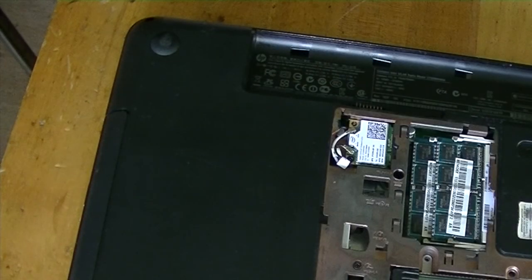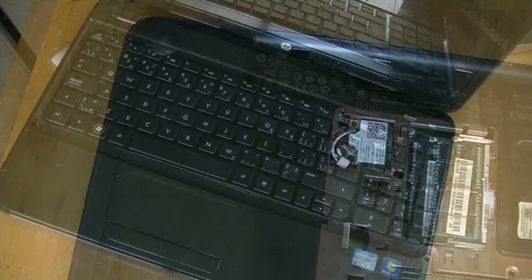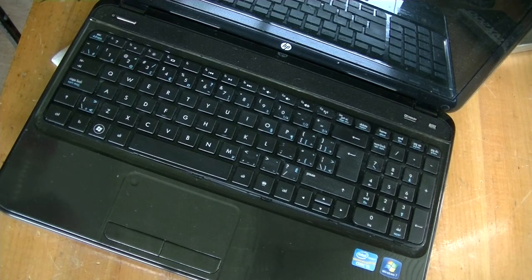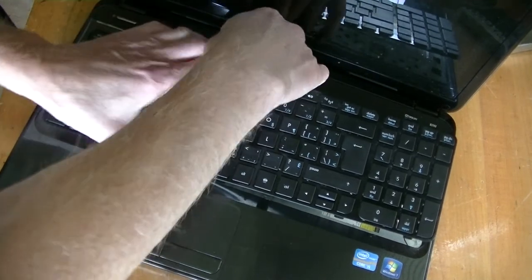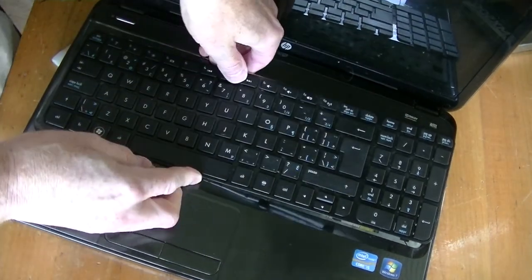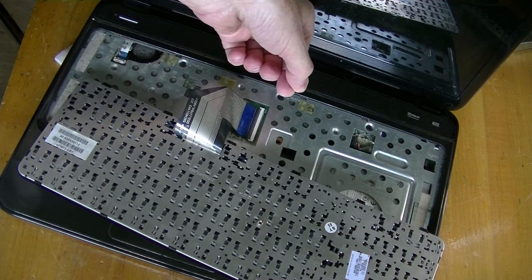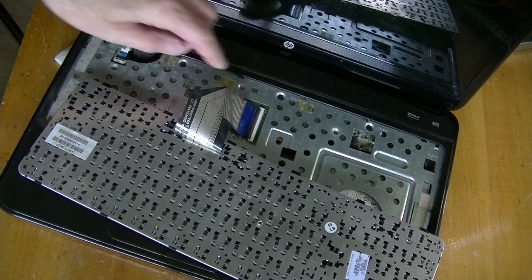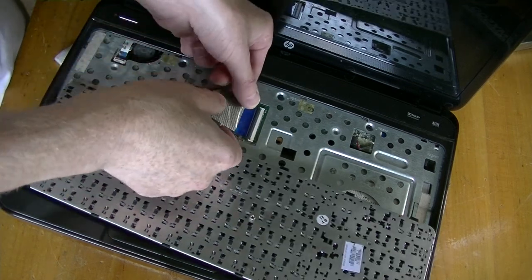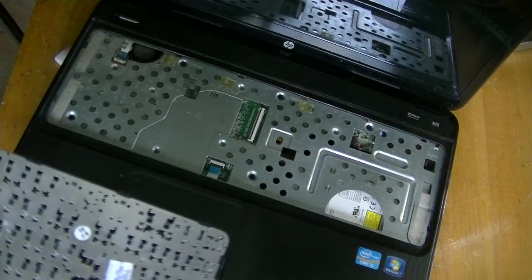Next we open the computer up and stand it on its end and push in this hole, and the keyboard should come out. The keyboard itself is flexible and does come out, though not all at once, and you'll have to ease it out of the case. Lift the black plastic catch or tilt the ribbon cable up — that will force the black catch open. Now it's out.